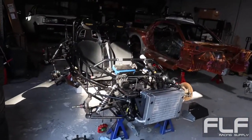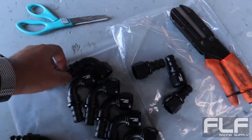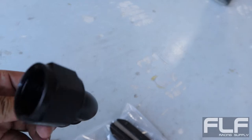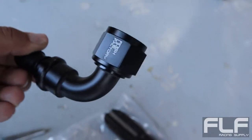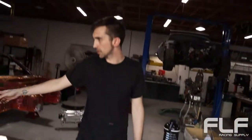I think you said this is just for this car, right? Yeah, all this stuff. The Dash-12 - what is this being used for? We've got the radiator system on the front, the water-to-air system, and then the oil lines. The Dash-12 fills the hard lines in the middle, and then we figure out the fuel, and the rest of this stuff gets ordered from you pretty soon.